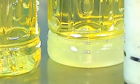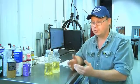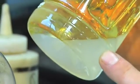although it still can happen. The gasoline in the tank at the gas station could have some water in it, and you could get it into your car. Isopropanol will mix with the water and the gasoline and allow it to get burned through your engine.